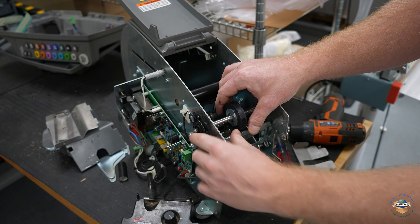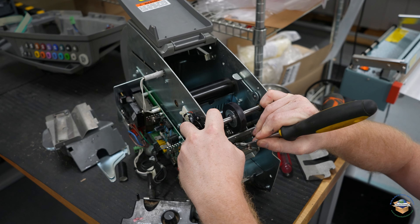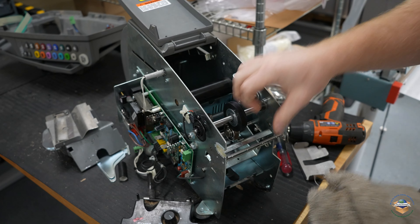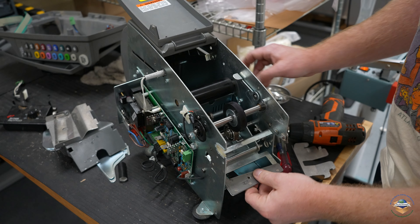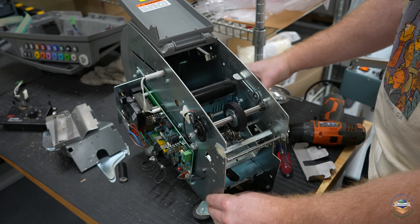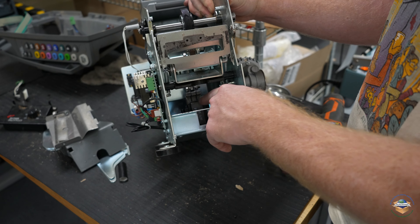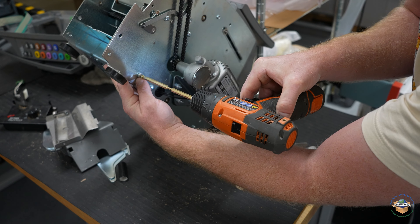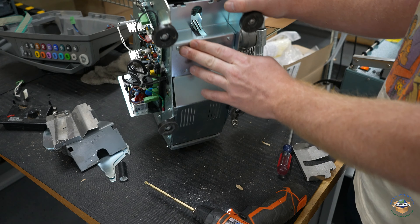If you find you still have a little buildup on the front of this blade, a window scraper can help get that — then go back over with the rag and wipe it down. Another thing I haven't shown before: if when you're running these machines it buzzes when it dispenses, down in here is your solenoid. You may find there's some buildup on that solenoid. This one's pretty clean, but I'll show you what I mean. There are four screws that hold this in — I'm going to take off the front two.